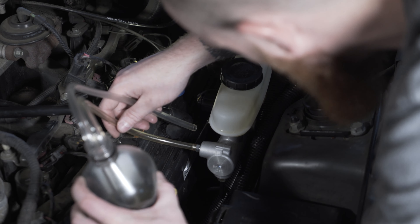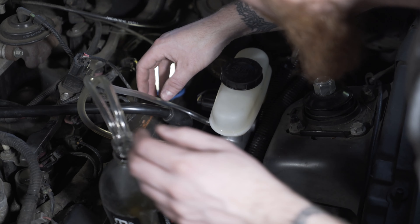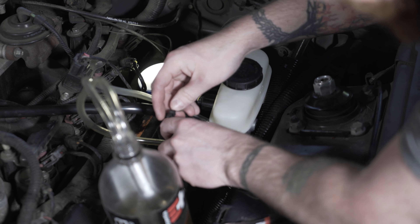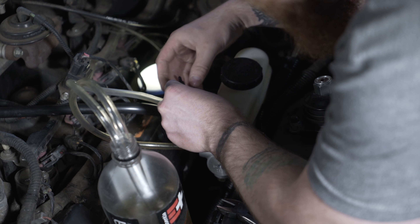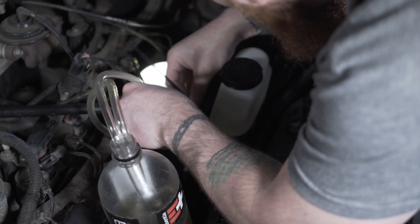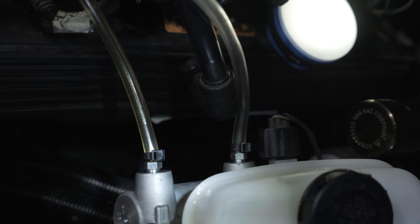I'll cover bleeding your brakes in a separate video. To make yourself a bleeder contraption, get a large water bottle and put some fluid or water in it — you need enough to submerge the ends of the plastic tubes. Place the water bottle such that the tubes are pointing upward in relation to the bleeder valves and the master cylinder. Use zip ties to fasten the tubes to the bleeder — try to get them tight so air doesn't get in, but be warned: if you tighten them too much it can cause the tube to crease, which in turn lets in air. Here's a look at how I have mine set up.